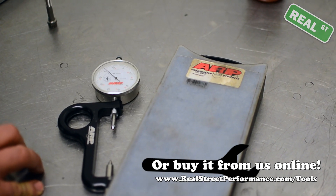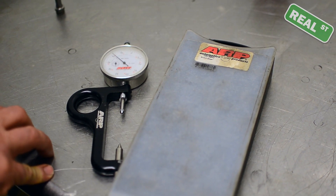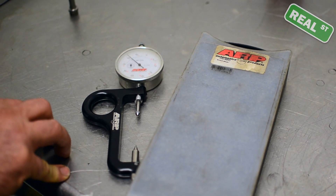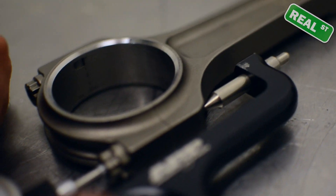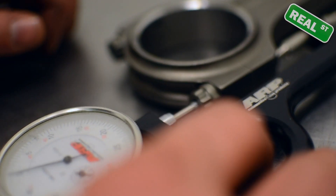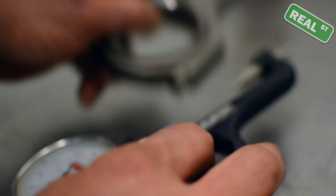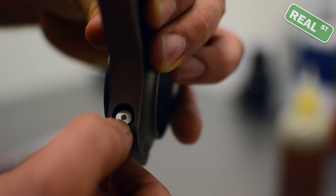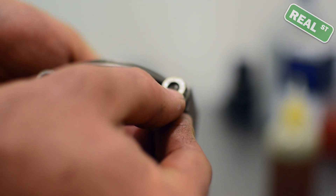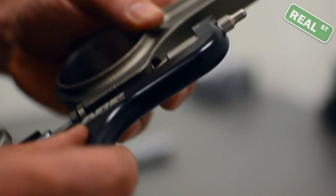It helps remove any inaccuracy that your torque wrench may have, because you're basically giving yourself a way to double check your math. You're going to want to check the bolt length at a relaxed state. The bolt has a little divot in the end and also a radius recessed area in the head that, when you put these two together, kind of snaps into place and it'll hang out there. You can then zero out the gauge.